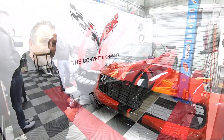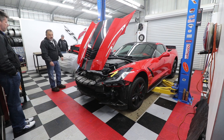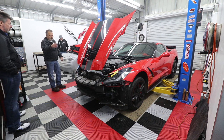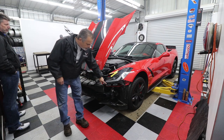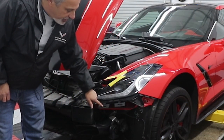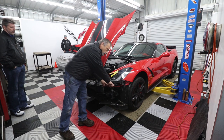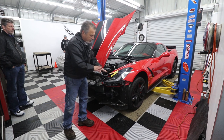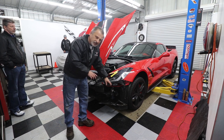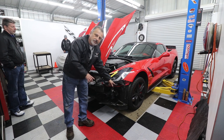We're all done with the grille, so the next step is putting it back on the car. Grab the bumper and bring it back over — John gives us a hand holding one side. One important thing to point out: there are a couple of little tabs — guides — on the inside of the bumper cover. They look almost like little sails. You want to make sure those go into the corresponding slots on the car; if they don't, the bumper won't line up and won't fit.